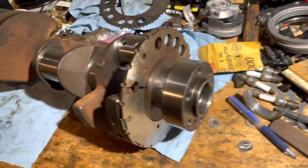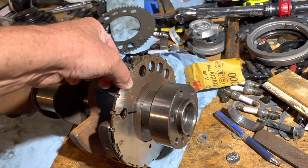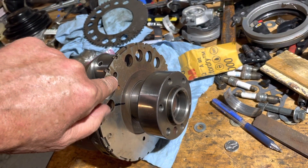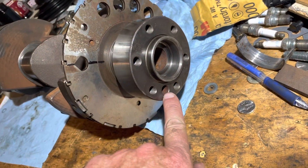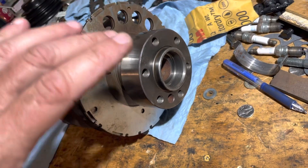So in preparation for that process, this wheel has to be oriented on this crankshaft in a precise location. And this hole right here is the key. There's a special tool you can buy that fits into that hole, and it fits into that hole right there, and it orients this wheel so that when you push it on, it's located in the right spot.